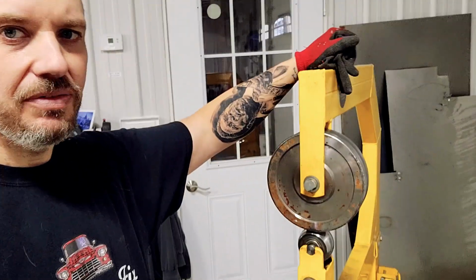But anyways, today, just a quick little video. I've got some things on the go, so I don't have a whole lot of time, but I'm going to try and whip off a rocker panel to show you. I'm going to use my friend here, the English wheel, and some 16 gauge cold rolled. I have an old section of a rocker panel that I'm using as a template for the radius.